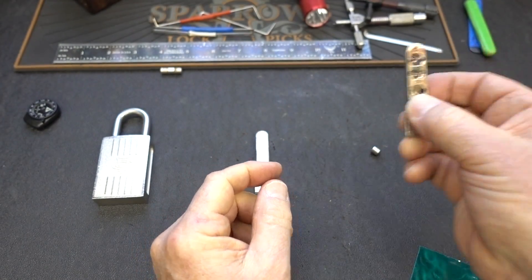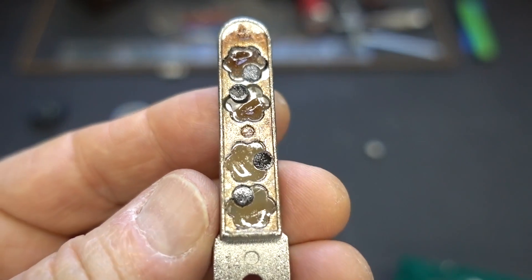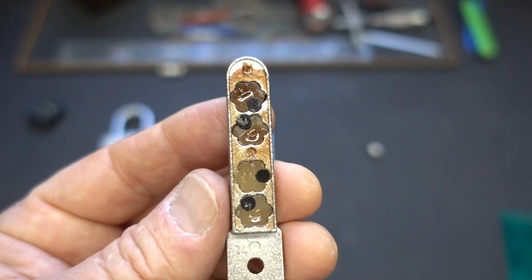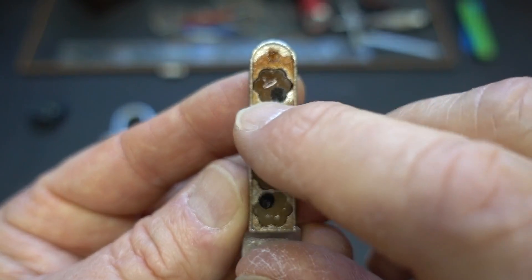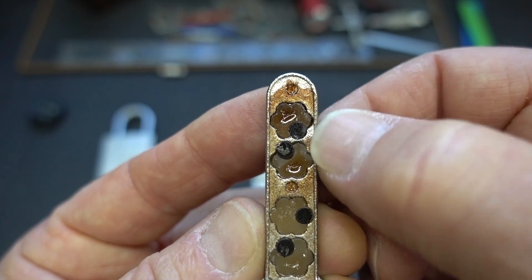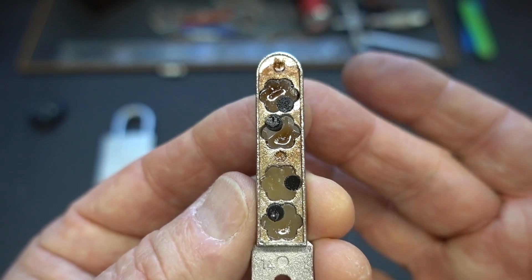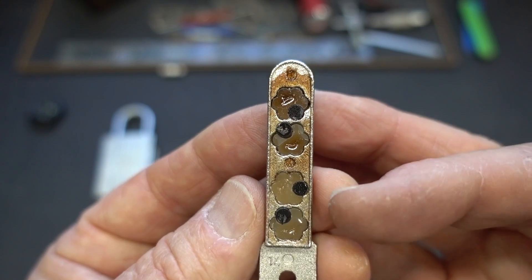Let's take a look at the inside of the key. With the foil removed from the top, we see our four magnets. It's the same — this is the extra key, by the way. It's ingenious the way they did this. They have these cloverleaf cutouts, and inside the cloverleaf they put a magnet in one of the orientations — five o'clock, 11 o'clock, three o'clock, 11 o'clock. They put the magnets in, fill it with epoxy, let it dry, and bang, there's your key. There are any number of different keys because you can use all those positions.